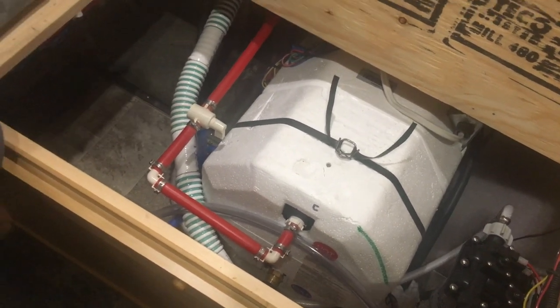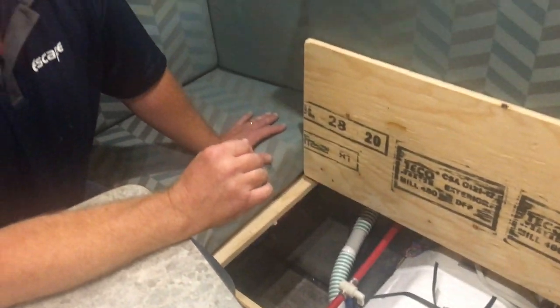If you're putting antifreeze in your trailer, that's six gallons of waste and you really don't want to have it in there cooking up and stuff. So always put it in bypass — it doesn't matter if you're doing the compressed air or the antifreeze method.